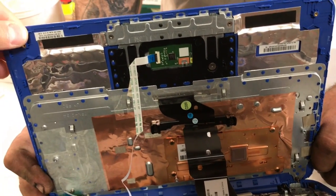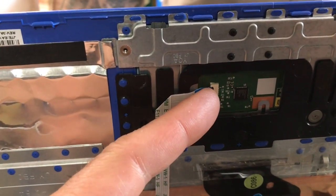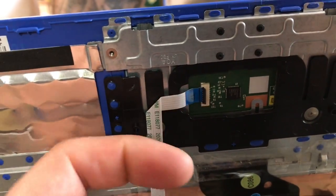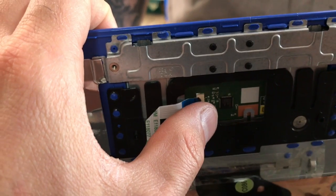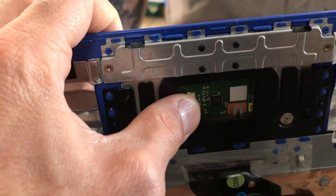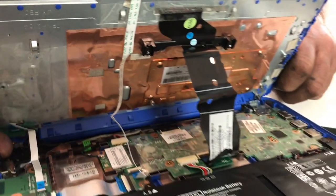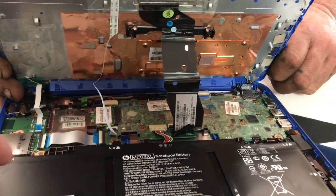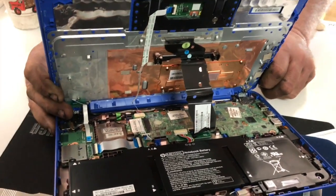Once you're in here you just got to look at it — you got screws if you're changing the keyboard. To show you how things unclip: stick your finger onto the brown part and flip that up, and now it'll eject. Don't just pull it out without flipping that up because you'll probably damage or break it. Those are pressure clips and they snap on — there are different clips in here. This video is only on how to get in here, but once you're in you should be able to do it yourself. If not, go watch a different video. Thumbs up, see you later.